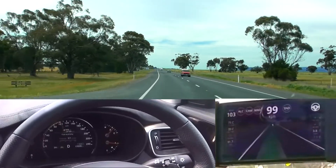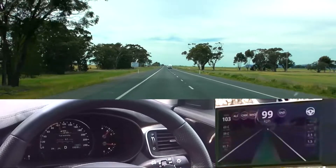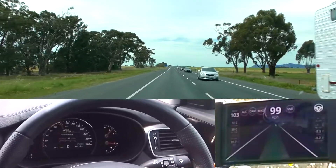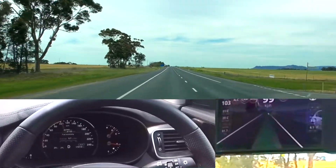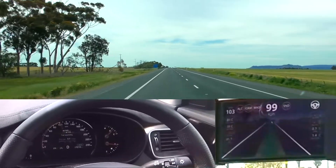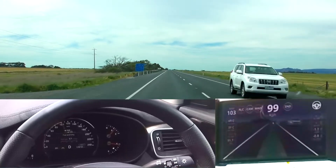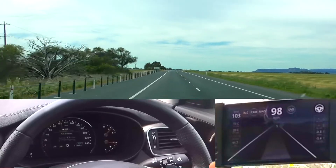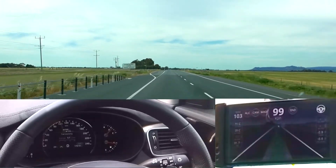If I enable cruise control again, now I'm steering with Eon - you can tell because it moved back into the center of the lane like it should. Now if I counter-steer a little bit, it beeps. So again I'll let OpenPilot steer - I'll edge towards the middle, move move move there we go - let go and OpenPilot pulls us back where we belong. We're using the camera not just for being able to cancel this and run on the factory system, we're using it for everything including lane departure.